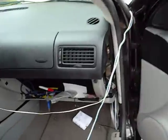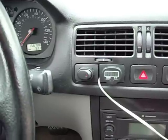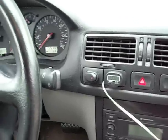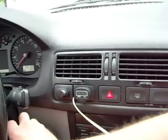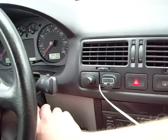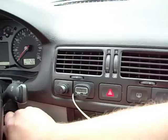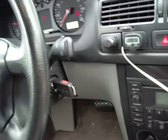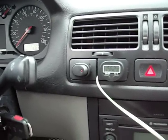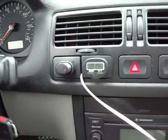They can actually be seen right here. Right now the thermometer's on — I'm not sure if you guys can read that, it looks like you can. That will give the coolant temperature that is recirculating from the engine into the coolant overflow reservoir. Let me go ahead and start up the car right now. It's been sitting here for just a few minutes, and obviously the lines on top of the engine just cool down over time. As that coolant flows, you can tell that the temperature starts to climb as it begins to equalize and reach an equilibrium thermally.